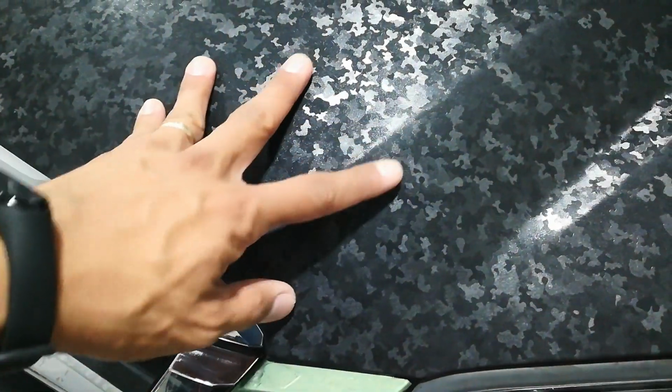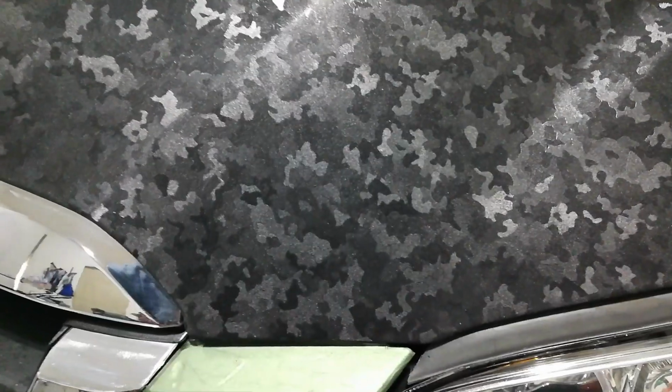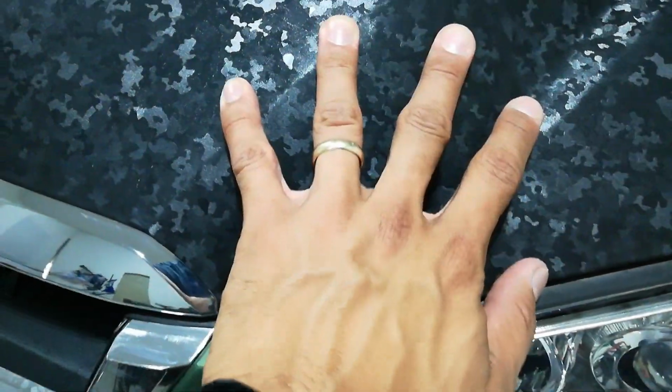And because of that, you have to account for it. Also, like I said, when I was working on getting these curves here, I did give it a little bit of heat because it's thicker and patterned. I did not want to stretch and pull too much, whereas something that's just a single solid color, you can stretch pretty good, and you're not going to distort any kind of pattern. You give it a good stretch here, you're going to distort the patterns. You're also going to distort the texture inside of it, which would then alter or destroy the light shifting effect that the texture has.